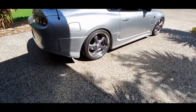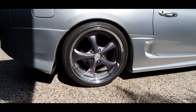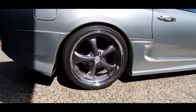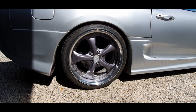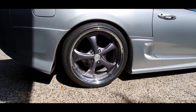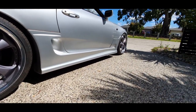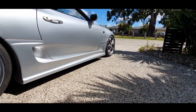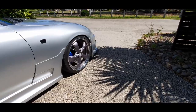We are running 19-inch VSKFs — 9.5 in the back, 8.5 in the front. We're running plus 39 fitment in the rear, plus 40 fitment in the front. That is terrible offset, so I'm running a 20mm spacer in the rear and a 35mm spacer in the front just to get some better fitment. I will be rebuilding these eventually with much deeper outer lips, but that's for another video.